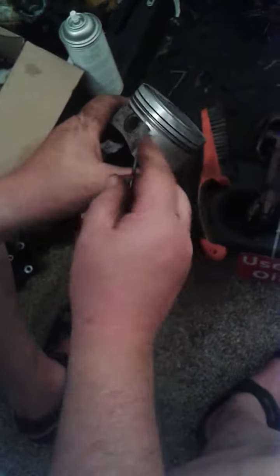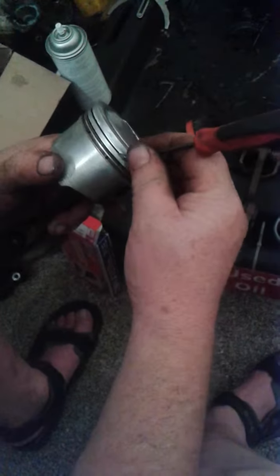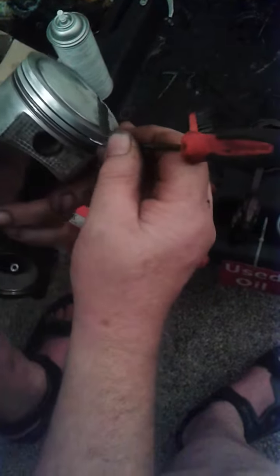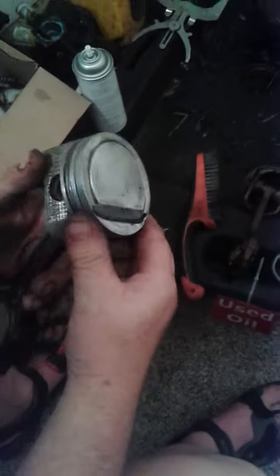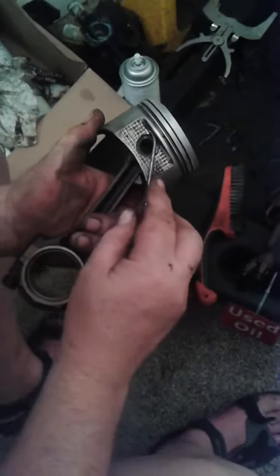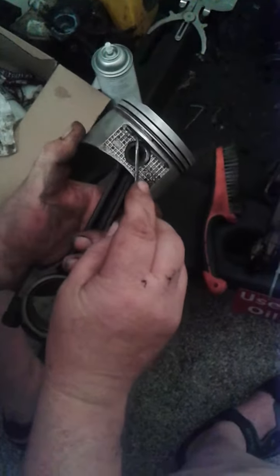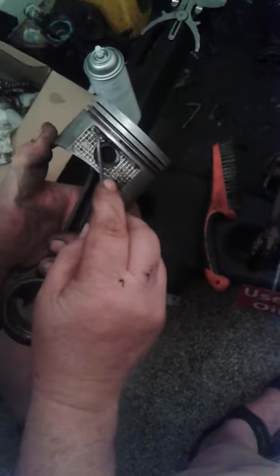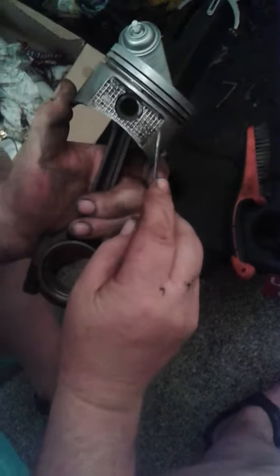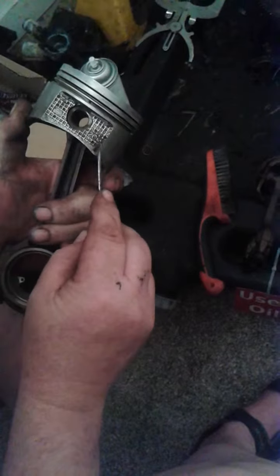Same for the first groove — on this particular piston, my land tool has not got the right size probe, so it's just a matter of gently working whatever's in there out. You could use a wire brush to get rid of a lot of the built-up carbon, but do so gently. Do not use a wire brush attached to a drill or an air tool — those will remove the carbon but they will also remove some of the metal substrate, and you want to avoid that at all costs.